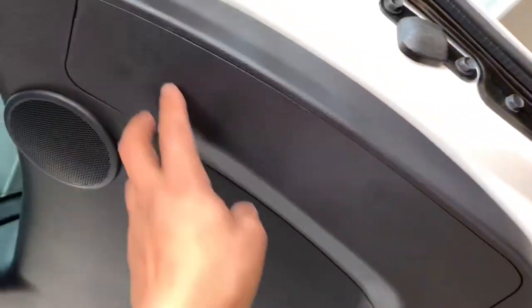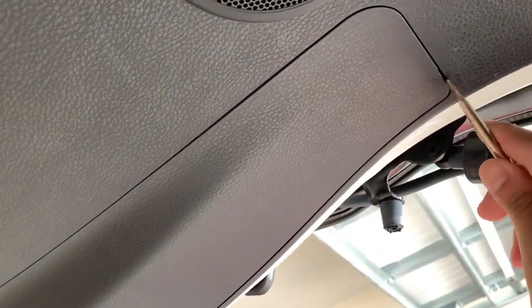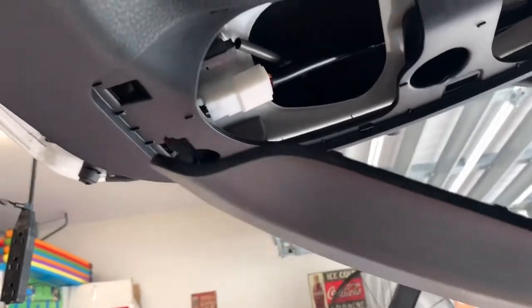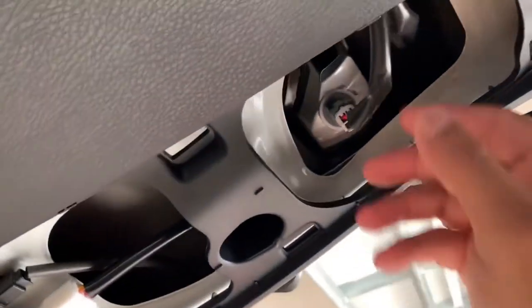The reverse lamps are super easy to install on these trucks. If you look at the very top of the hatch, you'll see a little slot — that is where you'll pick and pull to get this cover off. Stick a flat-head screwdriver in there, pry it open a little bit, hang on to it, and just pull this cover down. At the very end it's got little grooves where it's going to secure.